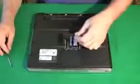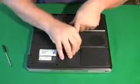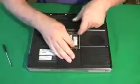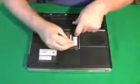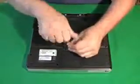and here I'm getting to the RAM. There's one stick in there. You just grab the two ends of the RAM holder and it'll pop up. Sometimes you have to use a device to get in there if it's too tight. And you pull the stick of RAM out.